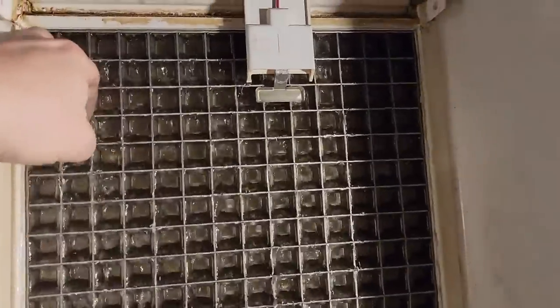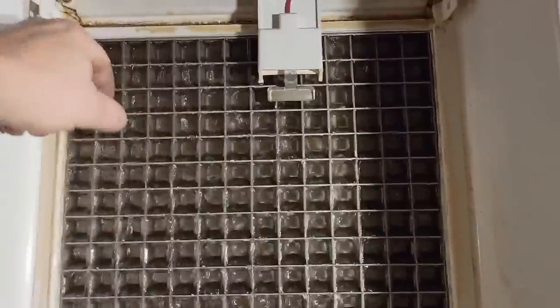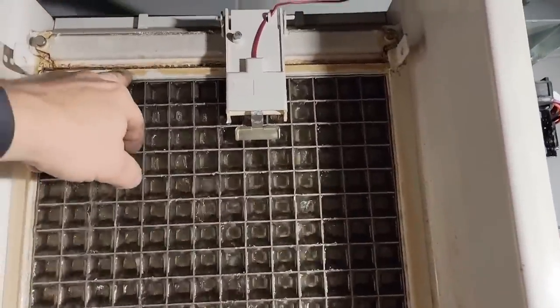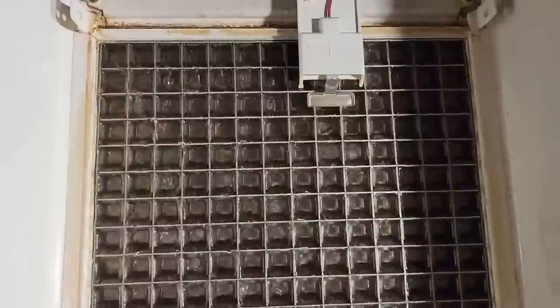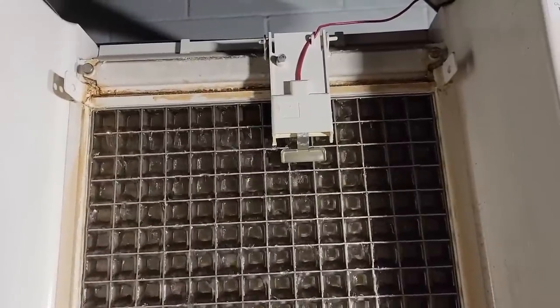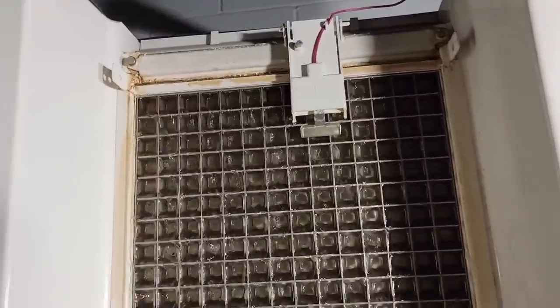We popped this off and wanted to see what our freeze pattern is. We've got a good freeze pattern — top left, top right, bottom left, bottom right, top down, all four corners. We've got ice on it, so we're freezing equally across it. The machine makes ice. All we know now is that most likely it's dirty. Most of the problems with ice machines is the accumulation of filth they get over time.